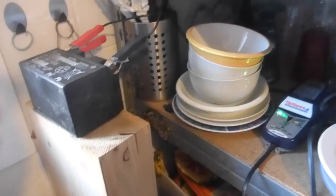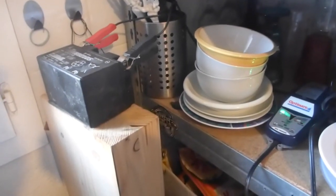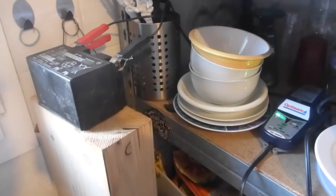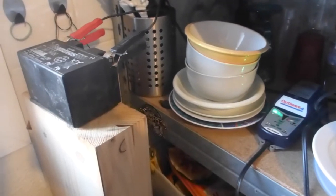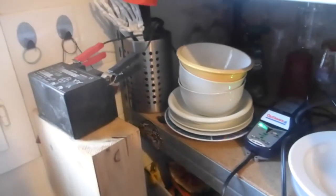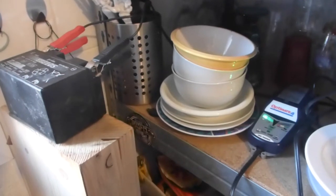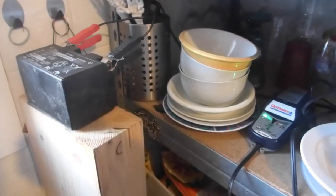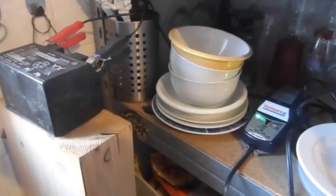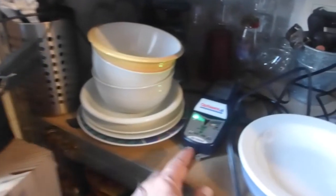So it drained completely once, then drained completely again, and then while sitting for four weeks without being ridden, the battery got weak enough where I could only drive it once — even if it was for 40 minutes — and when I got back home the motor wouldn't turn over. Even though I charged it fully with a more powerful charger, after a day or two the little red blinking light that fakes having an alarm system would go out. Obviously my battery was not holding its charge.